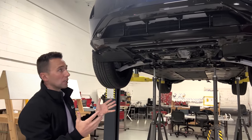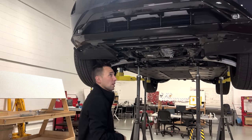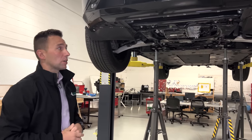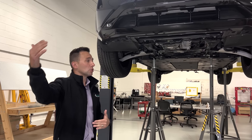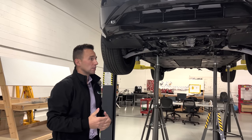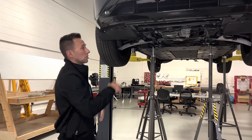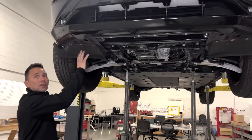The Ariya, interestingly enough, did not execute an AGS system on the A surface, which a lot of folks are doing. And the range is actually stating that there's not a lot on this vehicle, whether battery size or some of those aero characteristics. They're not getting a huge amount of range, right? They're not even to that 300 mile range target, which these days seems to be the barrier to entry for most BEVs. So it's interesting to me that they did not get there, and they didn't make some decisions like that from a range perspective.